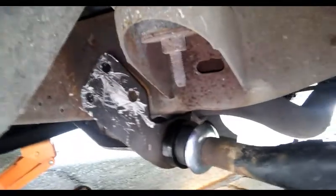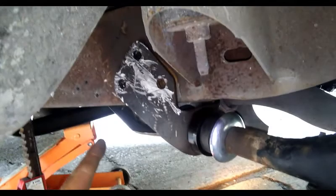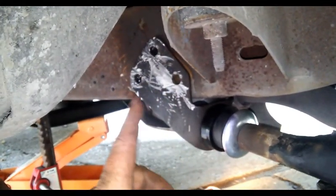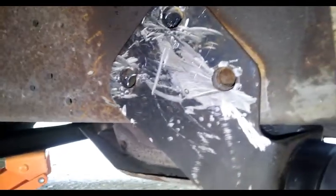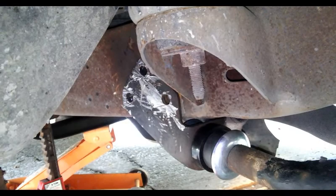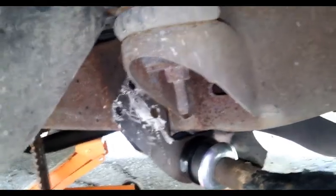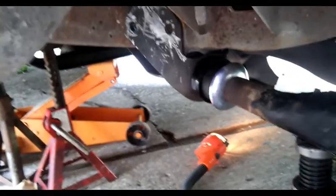After a little bit of work, you take the three bolts off the radius arm. This is on the passenger side — you're going to take a grinder and grind the bolts off; they're welded on there. You're not going to be able to undo the nuts, so you're going to have to cut them off, tap them through, and on the other side take the sawzall and cut the nuts and bolts off, then tap them out. Put a jack on there just to help with the weight.